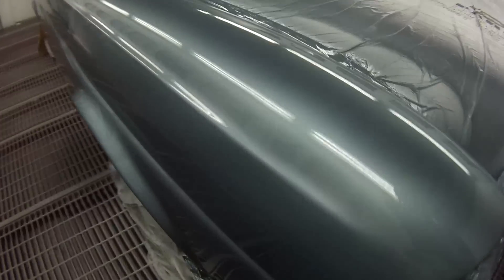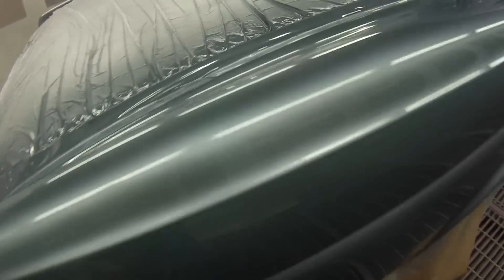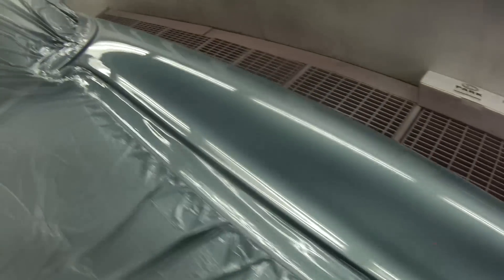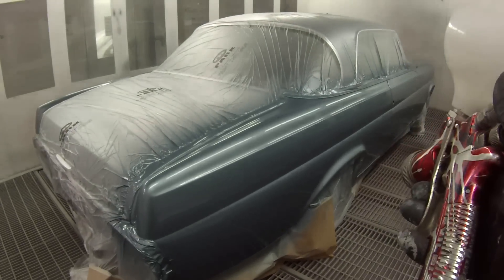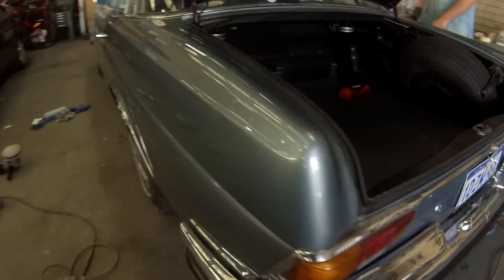I like to go out and clean my gun out - that gives me about five minutes - then come back and hit the bake button on the spray booth for about 30 to 45 minutes. If it's the last job of the day, I don't usually worry about baking them. I'm from Western Australia and it's quite warm here most of the time, and I prefer painting in the heat - clear coats are a lot easier to apply and it takes less time waiting in between coats. On a job like this in summer, by the time you've put one coat of base coat on and got back to the start, it's dry and ready for the next coat. Here we go with the final look over the car - it's being polished up by the lads out the back, and thankfully I usually don't have to do my own polishing.